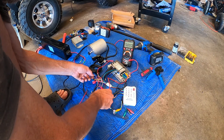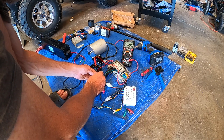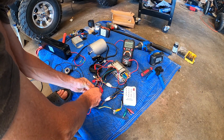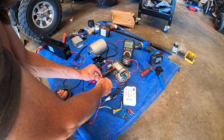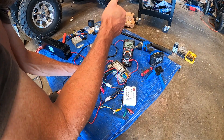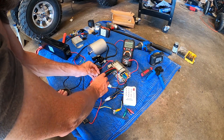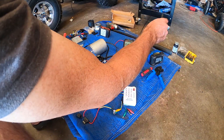The yellow wire alone could be something similar - or it could be a headlight wire. It's not doing anything when probed on its own, so it could be providing power to a headlight switch. When you flip that switch it would send battery voltage back down the yellow. The black is undoubtedly battery negative. It's just a matter of trial and error - probe them, check the voltage, and look for common themes that come from experience.